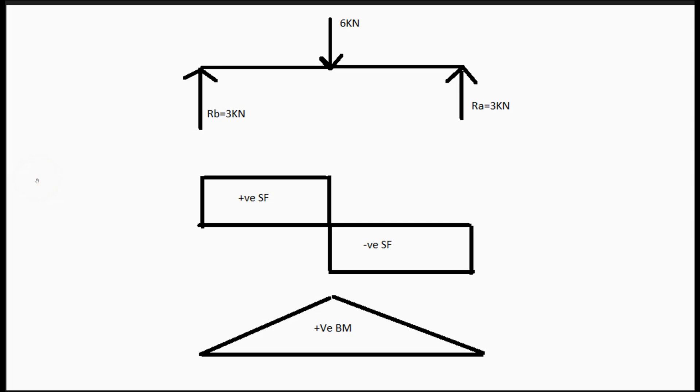I want to have a 30-second course on structural engineering so you can understand what I'm trying to do — basically to understand the behavior of the main chassis rails. These are just simple beams. The simplest example is what's called a simply supported beam: it sits on hinge supports at either end, loaded in the center. There are basically two force systems, or stress resultants, to be resisted. The first is the shear force: the support reaction must be transmitted along the beam to support the load, with a change of sign at center and an equal and opposite shear force going out to the other support.